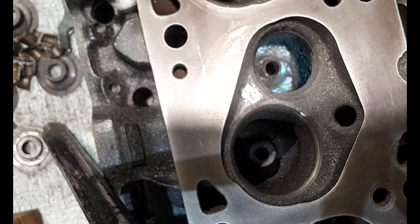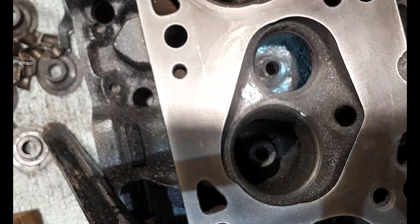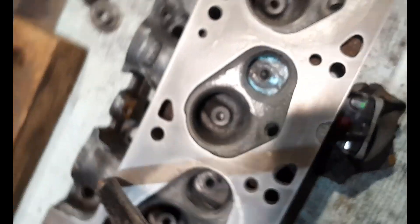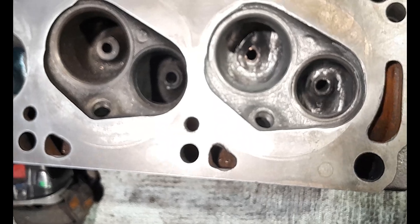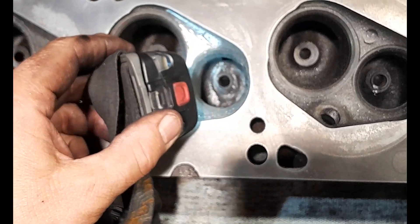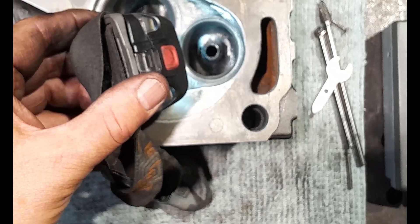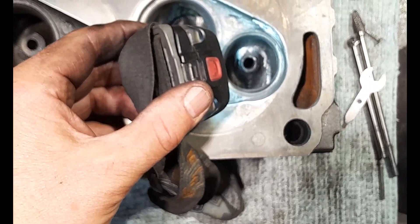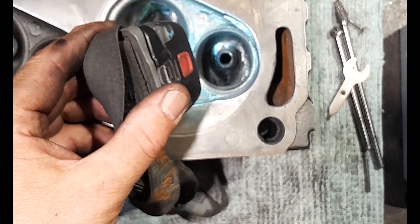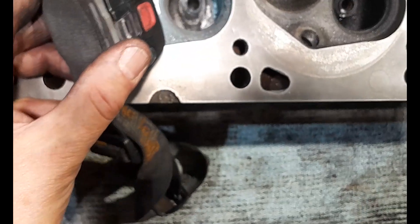I'm not going to do any more as far as shaping that valve guide boss - that's pretty good. It's actually thinner than the first one I've done, so I'm going to have to go back to the other one. The second one is definitely a little bit thinner, and the first one is still a little bit chunkier. I'm going to have to amend that first one to be a little more like this one. The back of this port has been done whereas I've only just started on this one, and this one has the crossover in the exhaust port - you can see the hole in the back there.